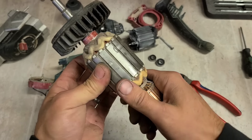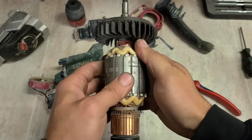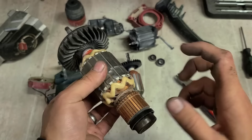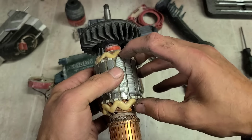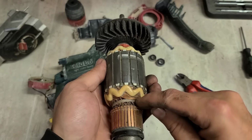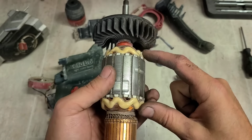And if you look at a Makita one, same idea. This one's just not using extra dips in the resin or twine. This is just using a resin gel that's been put on the windings at the end here. As you can imagine, that there to a degree is helping to hold everything together, but it's not exerting any pressure to actually clamp it down. That is mainly just there in case debris gets in and hits the windings. So that resin's there as actual protection.